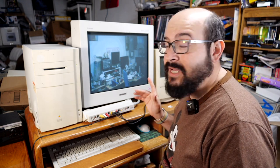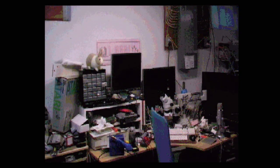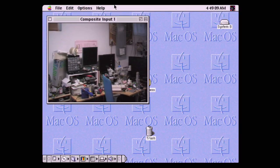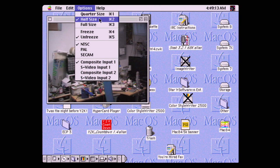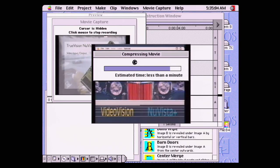I want to show you something — I was a bit foolish at first. I noticed the video wasn't capturing all the color information. You can see around the gradients there should be more color information — above the pink banner and where the stuffed rabbit is, there should be smoother transitions. Silly me, I realized the system was set to 256 colors. If I change that to millions of colors, the problem goes away and the video looks like what you'd have on a VCR or old television.